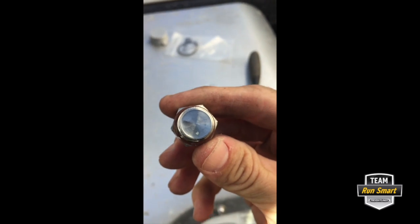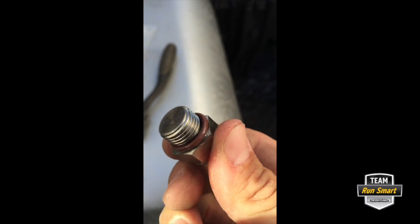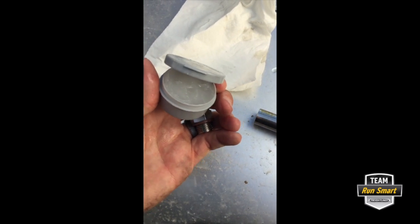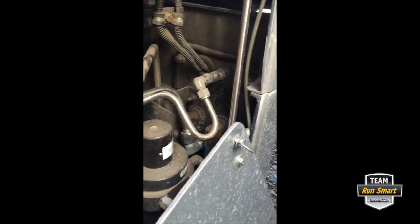As you can see, we just have a little tiny bit there. We're going to check the drain plug — it has a little bit on it — and go ahead and wipe it off. While doing so, inspect the o-ring on there to make sure it's not cracked. Then take a little bit of that silicone grease, dab a little on that o-ring to make sure it's lubed up, and we'll put it back on here nice and gently and tighten it back on.